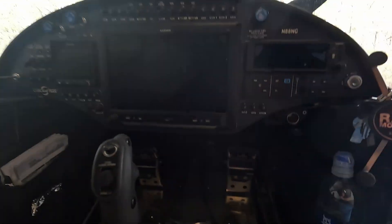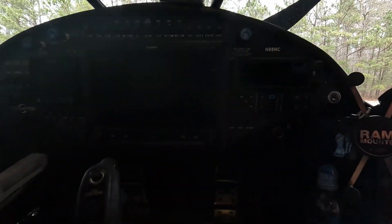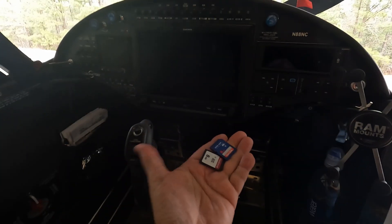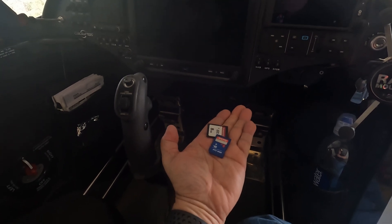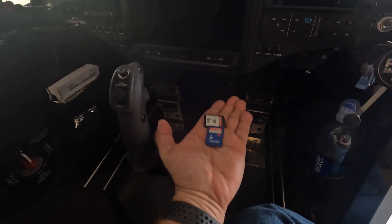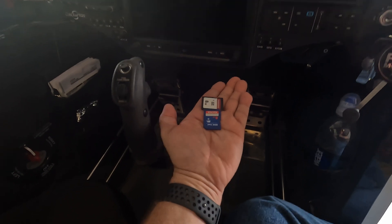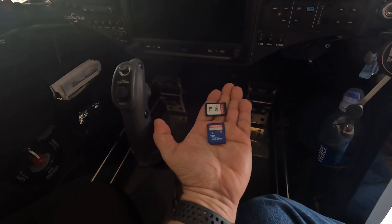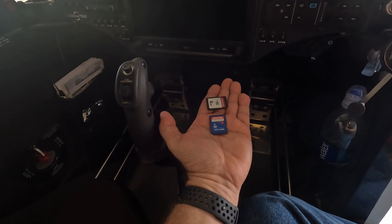I'm in the aircraft — I'm going to try to keep this low so I don't have the background lighting blacking out the avionics. Garmin suggests, or I think they require, 8 gig SD cards and I have plenty of them, but they're getting harder to find. Working with some of the newer G3X owners, I think a 16 gig works fine, and if you get larger you can solve the problem by partitioning an 8 gig drive with FAT32.